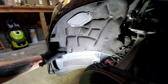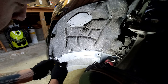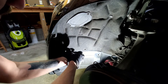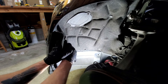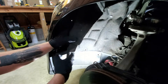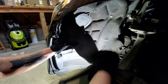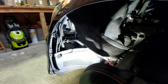The first thing we need to do is remove the felt fender liner — we're not going to remove it completely. We're just going to remove enough screws so that we can pull it back away from the car and use a bungee cord to secure it. That should give us access to the coolant pump. All these screws are out. This gets tucked into a little fender lip up here, so you just pull it away toward the engine and bend it up. Then we get a bungee cord to pull it completely out of the way and hook it up to the top of the coil springs.